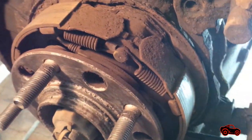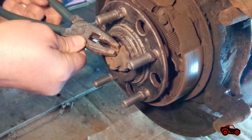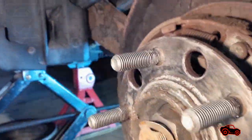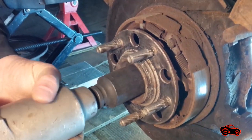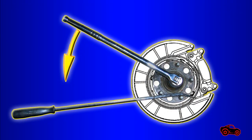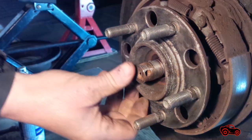When we perform that kind of job, we must take the time to examine how the parts are installed and find out the way they work. The cotter pin, the nut retainer, and the wave washer were removed to be able to unscrew the axle nut. A bit of cleaning is always good. We used an impact tool to unscrew the axle nut. If you don't have that tool, you can use a pry bar and a cheater bar. The shaft was loosened and the washer was removed.